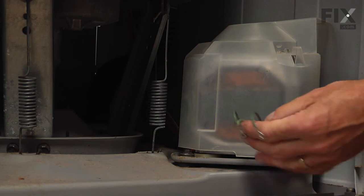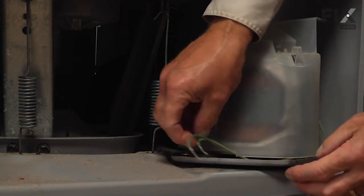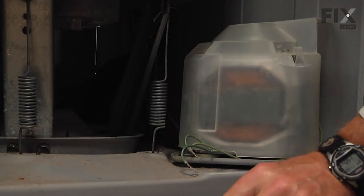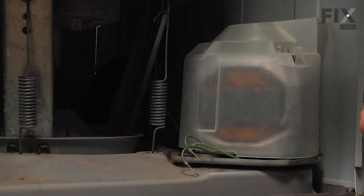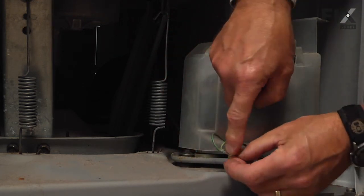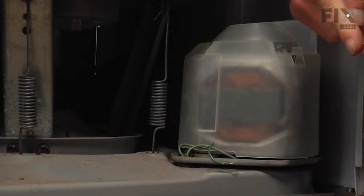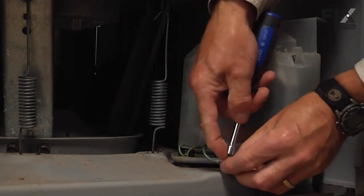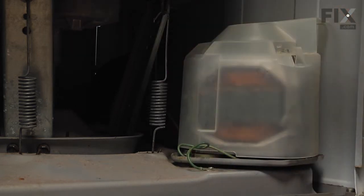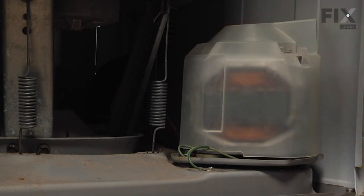Next, install the ground wire — pull it around beneath the motor cover. With the quarter-inch hex head machine thread screw, put that one in the motor base frame and make sure that screw is tight. Then install the self-tapping screw in the base. Now we're ready to put the front panel back on, and then we can turn the machine upside down and install the drive belt.